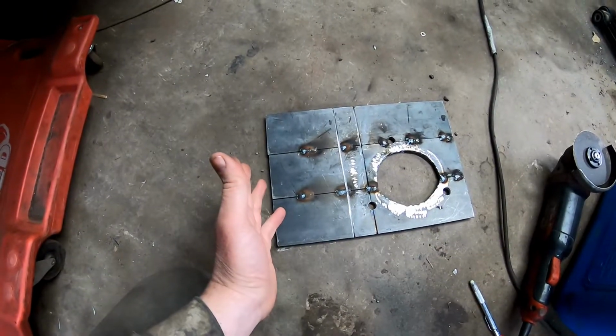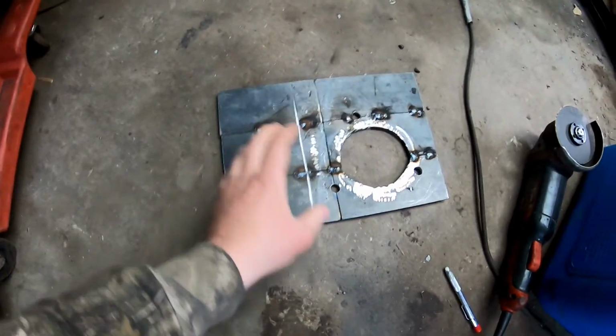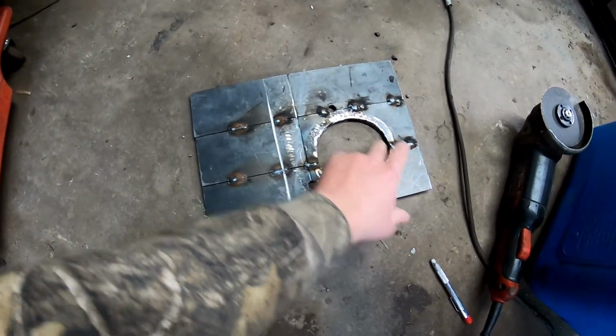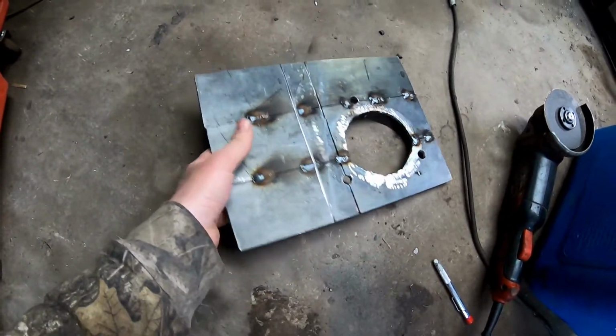Okay, you can see up there the nice shiny new gas tank straps, replacing the rusted ones. Gas tank is pretty good. Has a little bit of rust on it, but it's not deep or anything. I have most all of the rust cut out on the driver's side strut tower. And I made this, I fit it into the top, cut it with the torch, drilled the holes where the struts are where the strut will mount.